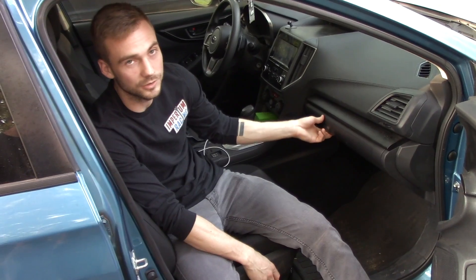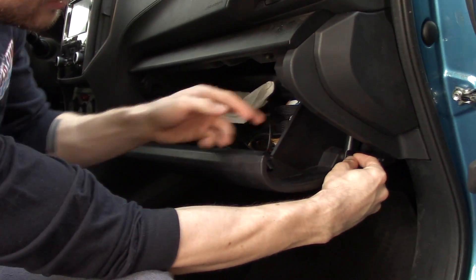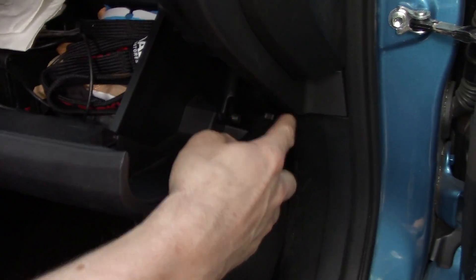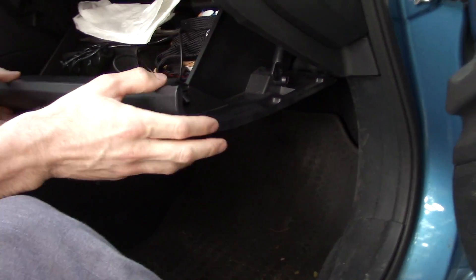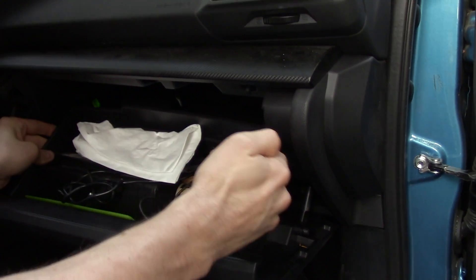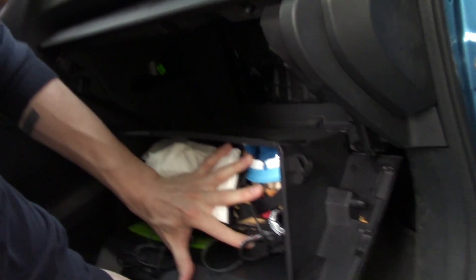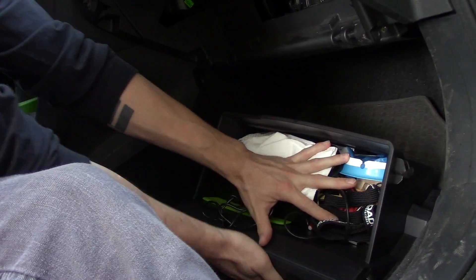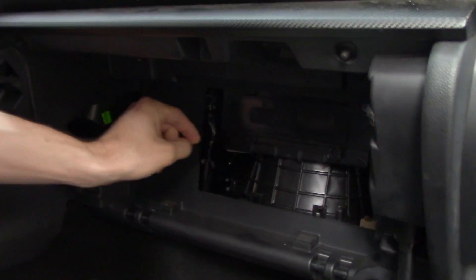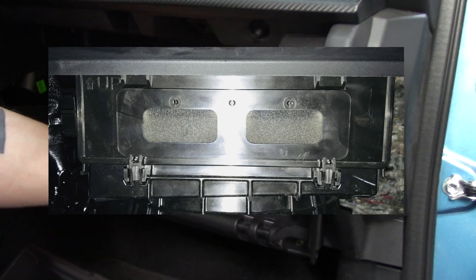On the Subaru, all you got to do is open the glove box. There's a little tab right here that keeps it from opening too far — just squeeze that and pop it off. Then squeeze the tabs and it'll just pop right off. After that there are two more tabs right here that keep it from opening; just push those in a little bit, squeeze in on both sides. Lower it down until it comes off — once you tilt it far enough it'll just come off. Then up in here there are squeeze tabs, one here and one here — squeeze the outside and pull out.